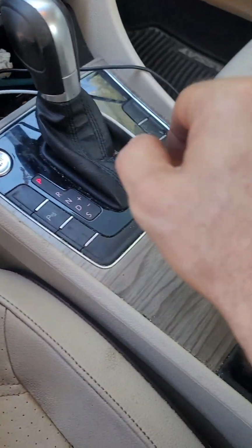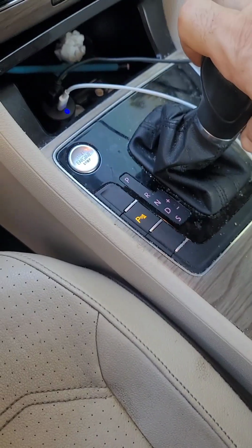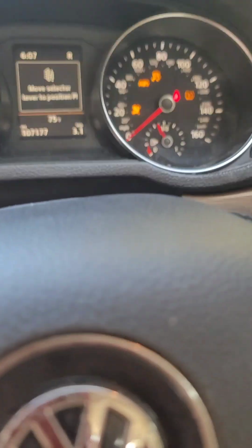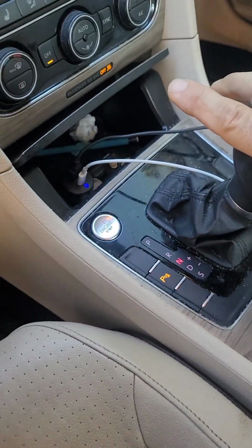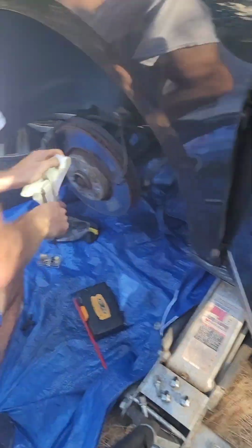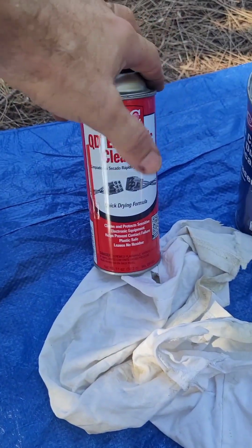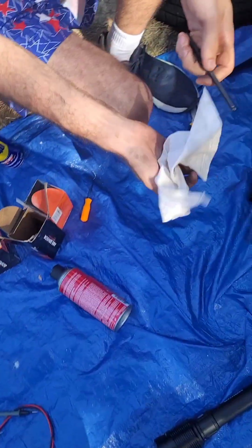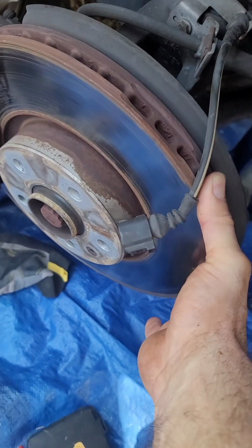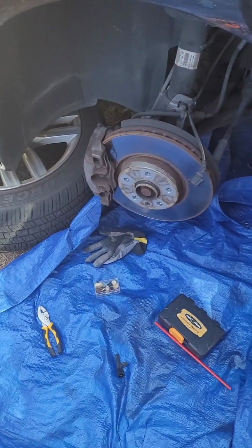We wanted to rotate the rotor to clean the hub inside, but our car has a brake on it. So the only thing we are trying to do is go in neutral, like this, neutral, and now we should be able to rotate. Try? Yeah, perfect. Okay, so the car is gonna get crazy, but what you want to do is stick something inside the hole and clean it. We are gonna clean it with a contact cleaner, or you can use brake cleaner, but I prefer to use this type of solvent. And we are gonna put a rag on something that goes inside, like an Allen key, stick it inside the hole and make the hub rotate. The only way to rotate in this car is to have it in neutral. And that should fix our problem, because I'm pretty sure it's the rust.